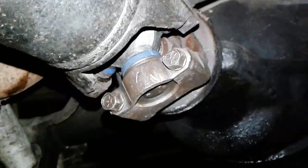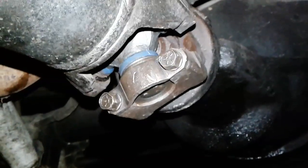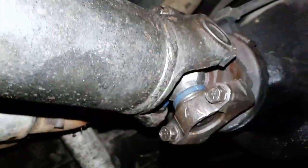I used the wheel chocks as well because I got the parking brake on and the wheel chock on the front wheel — that way when I take the drive shaft off it doesn't accidentally run me over into the garage. And here's my Snap-on creeper. So basically you take those two bolts holding that clip, get the straps off, and it easily slides right off the slip yoke where the transmission is.